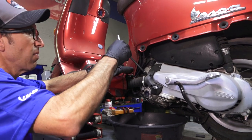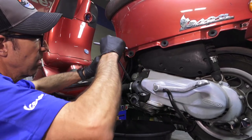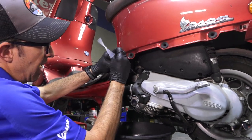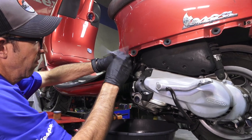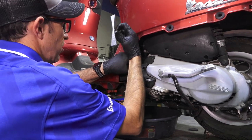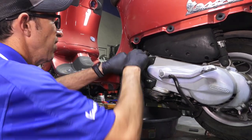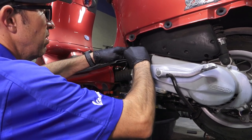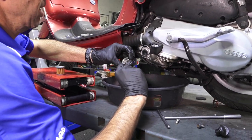I have an oil filter ready to go — we still have these available: OF7-HF and RMS, two different brands. It's just a little cartridge filter. They're not very convenient compared to the newer Vespas that have a spin-on filter. This cover — you've got to take extra care because we do not have the O-rings; it's a specialized O-ring for this cover. Back when I worked with these more, I found these covers never sealed all that well. And what a messy design — it just drips all over the place.